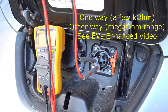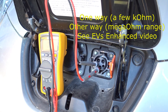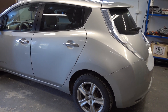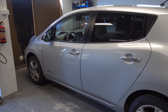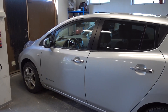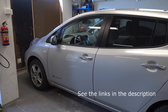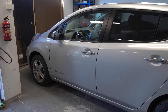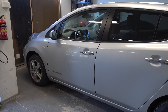So there's definitely something wrong with this diode. I'll put up on screen the normal numbers that you should be seeing. Before we go ahead and tear out the onboard charger, a few people have had some great luck with adding a diode in line with the Type 1 port at the front of the car. But this car doesn't seem to exhibit the same resistance values as those, so unfortunately we're gonna have to take a look at the onboard charger itself.